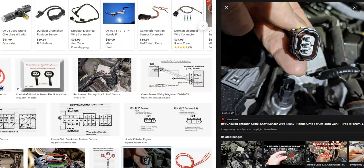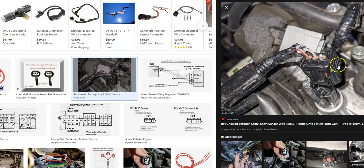There'll be a fuse in there labeled something like SNS or sensor. It'll control this and the camshaft position sensor quite often — they're both on the same fuse on the same circuit. There are some YouTube videos on what to check when it comes to this wiring, but basically just be sure that the wiring is good and that the fuse is not blown.